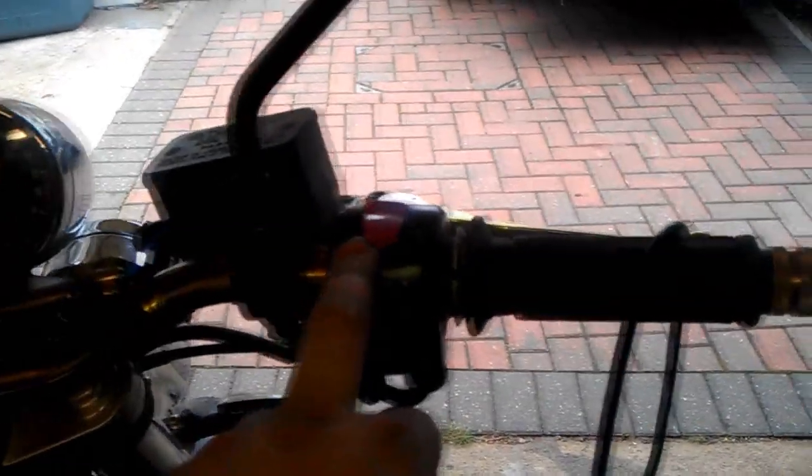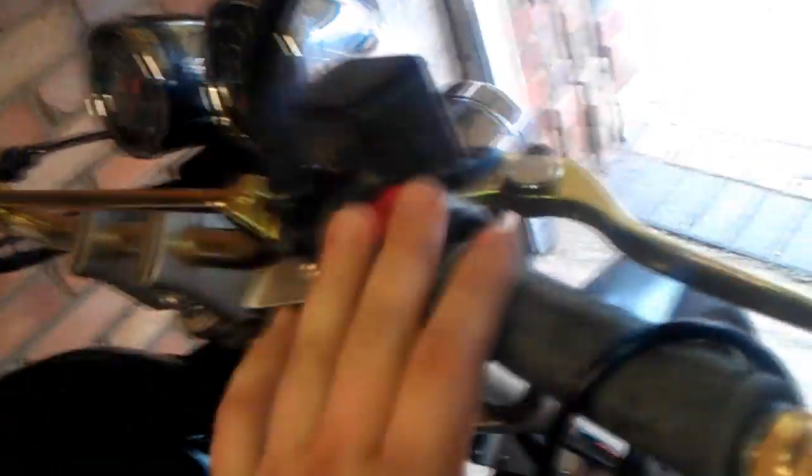So I've got to put those in. What I'm going to do is — on this bike it doesn't actually have a relay for the lights as standard, so all the current is going through the switch into the lights. Obviously it's trying to power two lights when it's only supposed to power one. So I think the contacts in the switch are probably dirty, so I'm going to clean those out. But also I'm going to run a direct link from the battery to the lights, and for that I've got a couple of relays here.